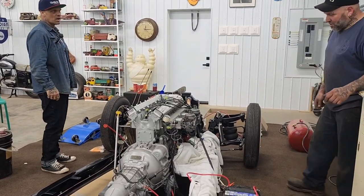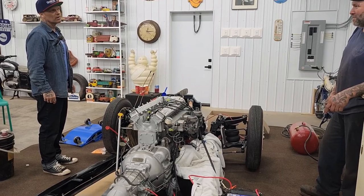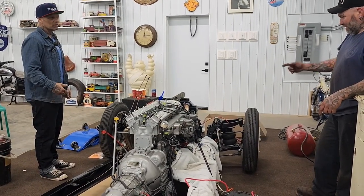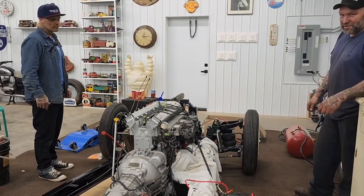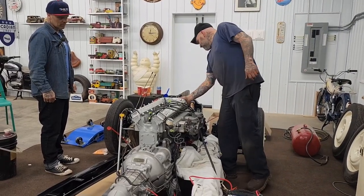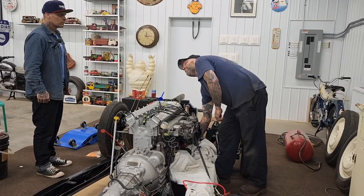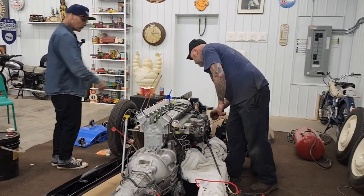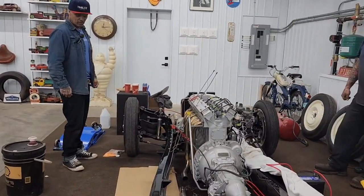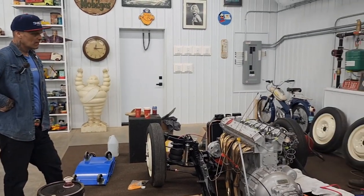Yeah, we'll let the carburetor set and we'll try it again, and I think we'll see. Got some of that Sea Foam and ATF through there now. What's that leaking? That's the oil dropping back from the heads down there. Now it's circulating. Before, that bottom one was cold. You could tell she was circulating good. It sounds way better, eh? It's coming around.